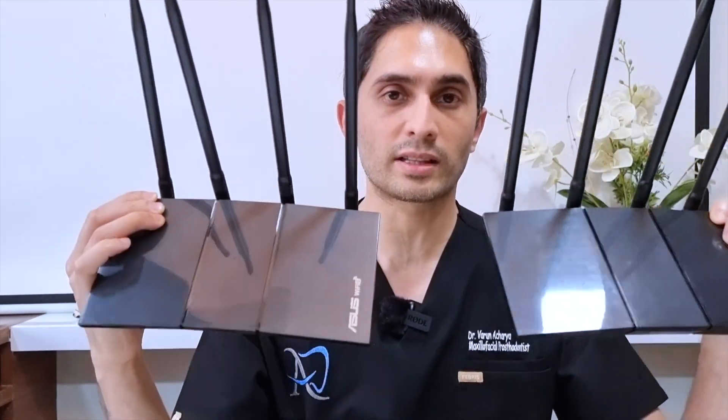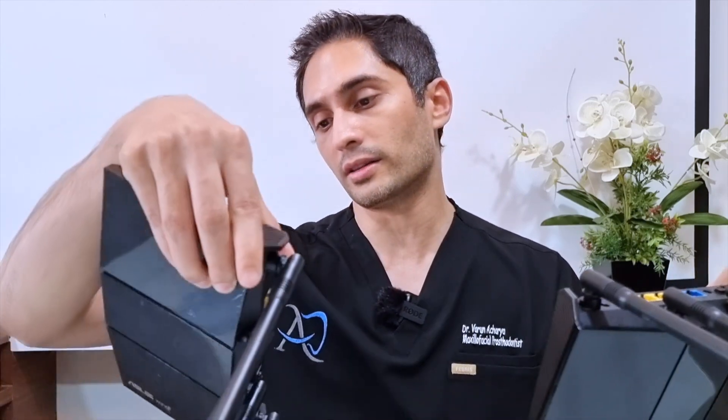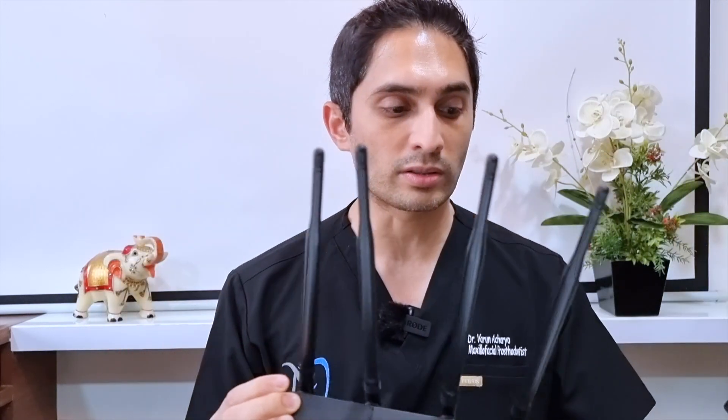After a lot of research, I bought into ASUS. We have two identical routers here — the RT-AX1800HP — at about six to seven thousand rupees each. You could go one step lower with the AX55. The reason I went for these is they have something called AiMesh: you set up one router as the master and the other as the slave, and they share the same network name across any number of routers you want to add. If you have ten rooms and want five routers, they all share the same Wi-Fi network, and most importantly the mesh does the handoff so your TRIOS connects to the nearest router instead of the previously connected one far away.